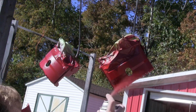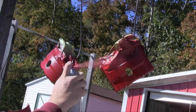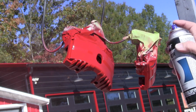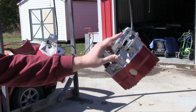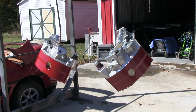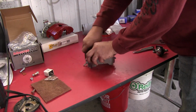The ceramic resins in this paint help withstand intermittent temperatures up to 500 degrees. With the proper prep work, you'll have a final finish that'll be resistant to chipping, brake dust, and automotive chemicals. The paint sprays and lays out very similar to Duplicolor's engine enamel. Color options include red, gloss black, matte black, blue, silver, and yellow.